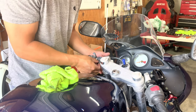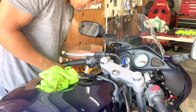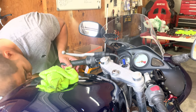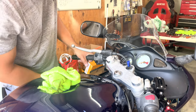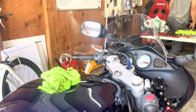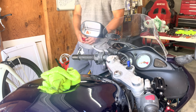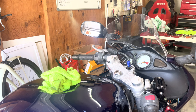The clutch side is a little more involved, because in order to pull the clutch lever out I have to slide the whole thing out of the handlebars. That means I've got to take everything off — the grips, the sliders, and the turn signal assembly. That's all going to come out, and this thing was being a pain — it didn't want to get unscrewed, so I had to get creative to get it all out.